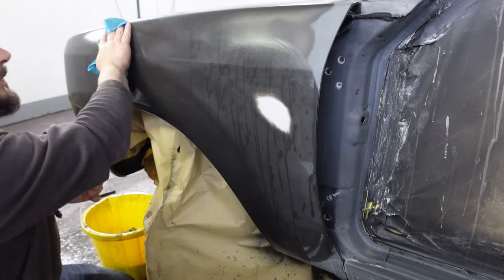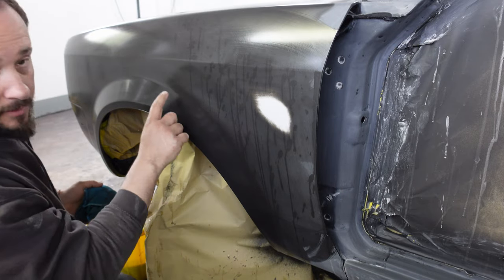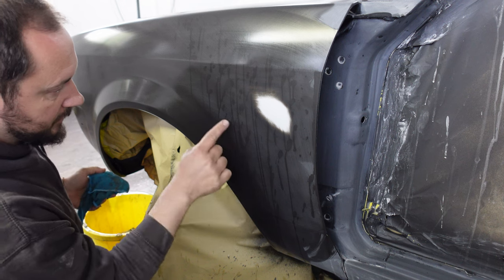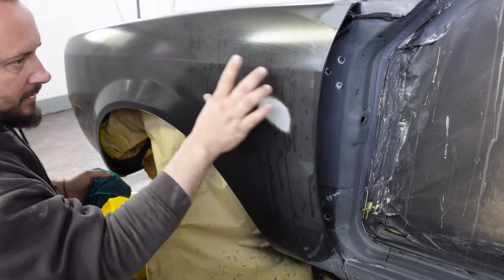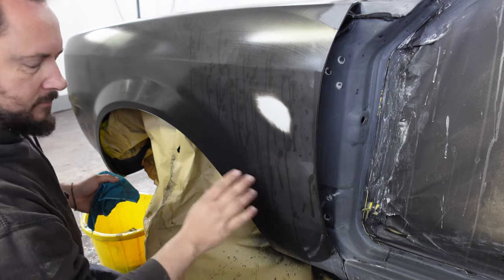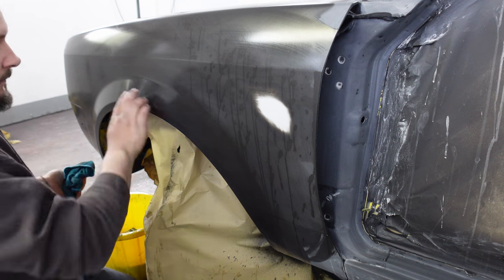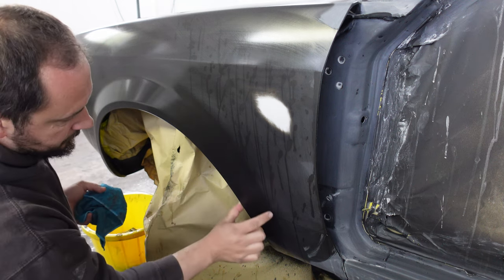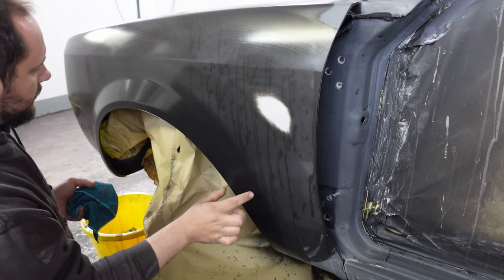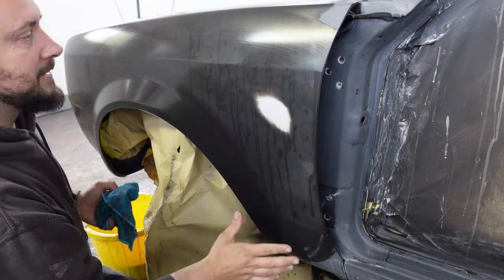You can see now the wheel arch I have sanded - it's nice and smooth and black without any of these greyer cut lines in it, because this area had a harsher grey. You can see here where this is the 500 area where I've just been sanding, and this is the 320 area that still needs sanding. That's what I was trying to get out.